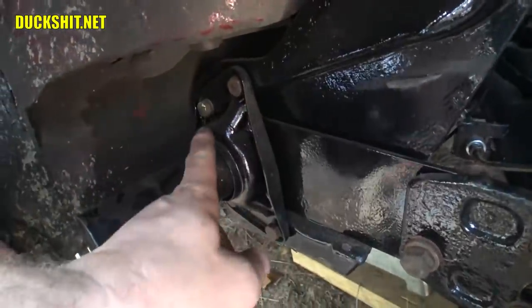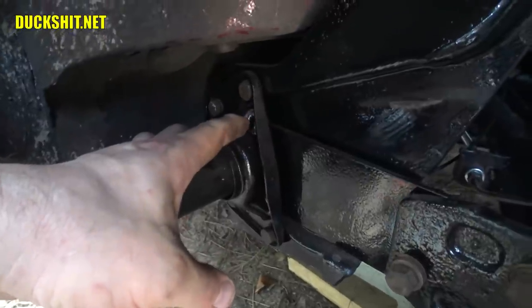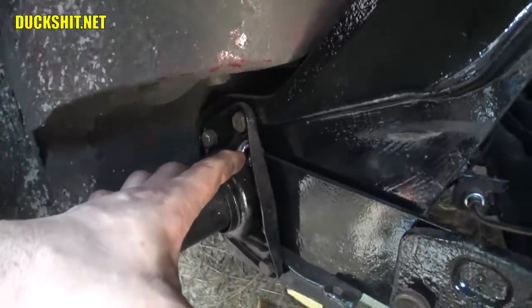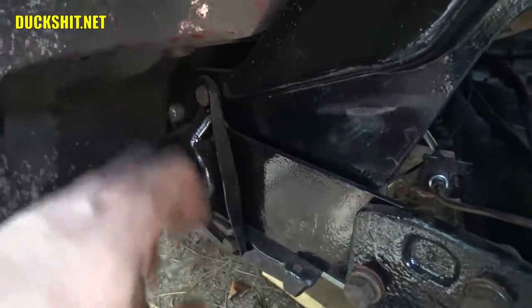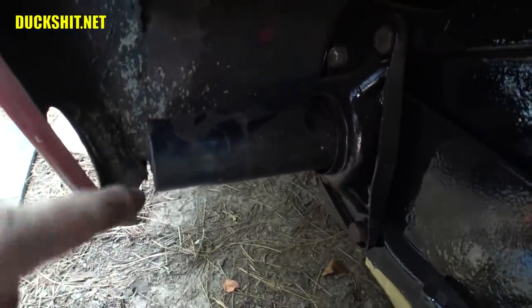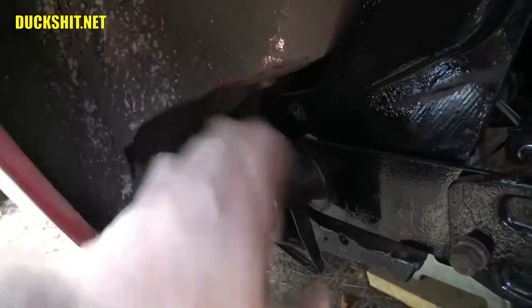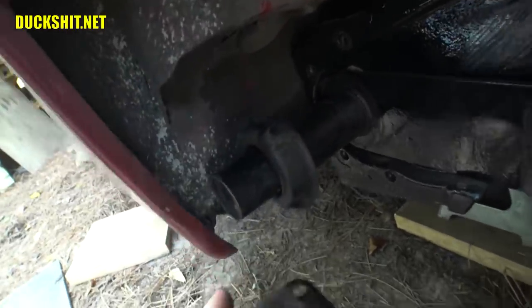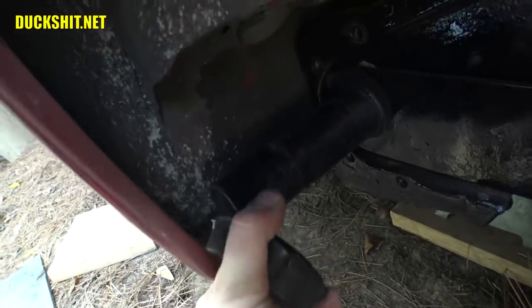These four bolts on the spring plate cover have to come off — one up under here as well. They're usually 14 or 15mm. I've found before that sometimes these could be any size if some idiot removed it and decided to push some American-threaded bolts in. In this case these are the original bolts and everything fits normally, so we're just going to loosen them up and pop that cap right off. And if we get lucky, it should clear the end and come out from between the fender.